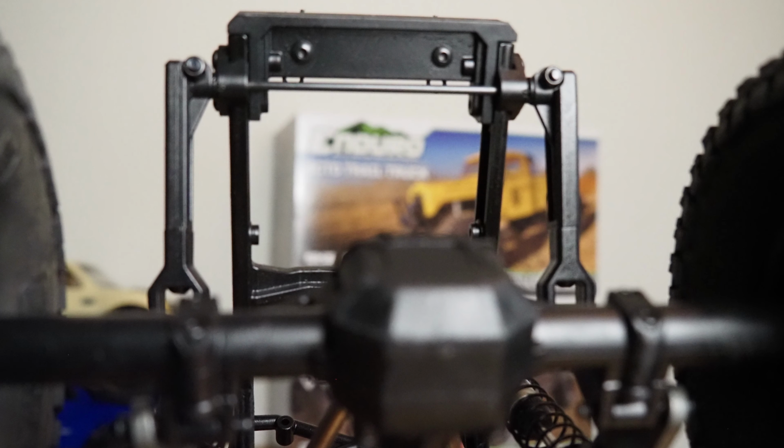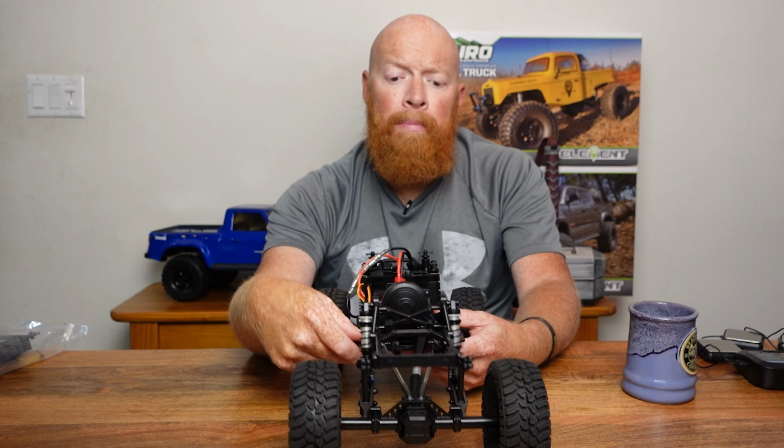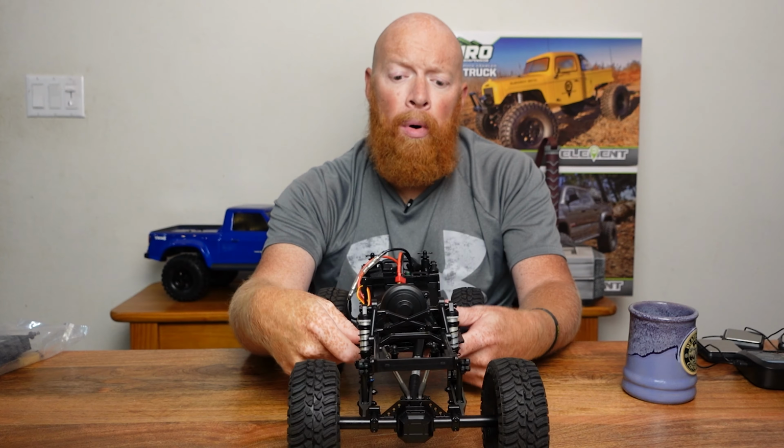It's really anti. And in both cases, whether it's on a rock racer or a drag car, what you're basically trying to do is keep both tires planted so that when you have torque twist, that tire doesn't lift up. What happens in this one in particular is that it has a captured roll bar. The roll bar is not sitting outside like some sway bars do. They sit outside, and the pressure on those only comes from the fact that they're attached to a portion of the rear arm that allows the pressure to be put down on the roll bar. And then it goes to the other side.